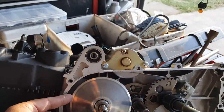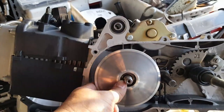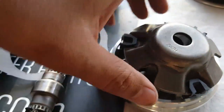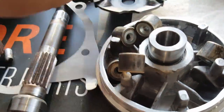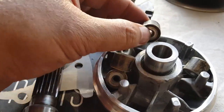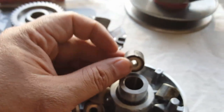So we're going to go ahead and change the variators to some Dr. Pulley rollers. I'm going to take it off — hopefully the rollers are intact. That's how they look right here — these are just the regular rollers. You can see they're pretty worn out; they've developed flat spots. That means you need to change them out. This is a good indicator right here — that flat spot tells you when it needs to be changed.